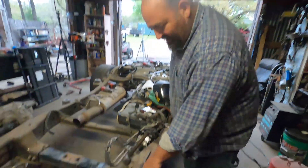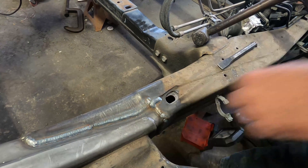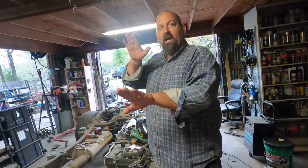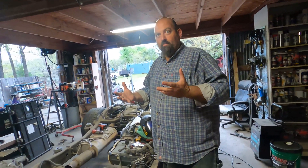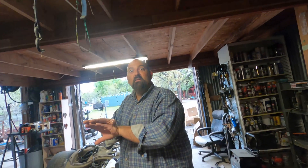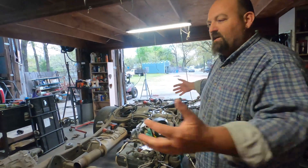This is one of my complaints with General Motors — whether you're talking about the body or all this stuff, if you've got an oval hole in this piece and an oval hole in that piece, logically you'd think those holes should end up centered on each other. In a body shop, if you have two panels welded together you'd think the edges should match. But this has a plus or minus four millimeter tolerance and the edges have a plus or minus three millimeter tolerance, so you can't tell dimensionally how good the alignment is just by looking at those holes.